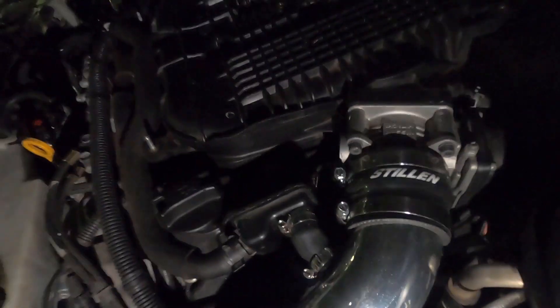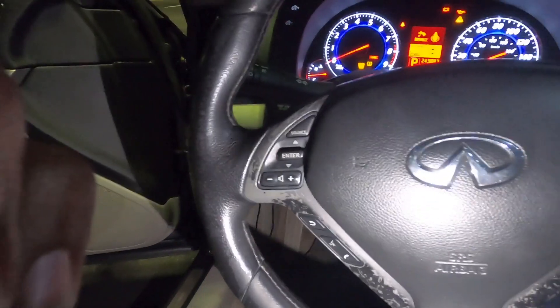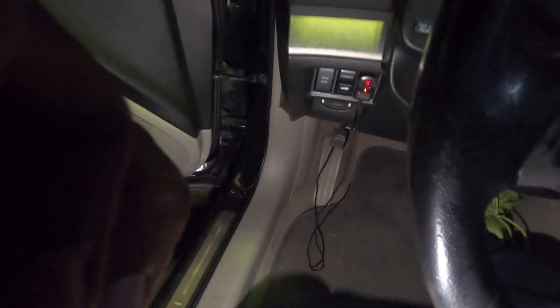If you touch the throttle 25%, your throttle body will open up 25%. So let's say if I want to floor it — instead of the throttle body gradually going all the way to 100% slowly but surely, it's now going to open up 100% as soon as I hit the throttle. I don't have to wait for it to go from 5% to 10% to 20% — as soon as I touch that gas it opens up. If I floor it halfway, it's still going to feel like it's opened up even more because you've eliminated the lag and delay between the throttle body and the pedal response.